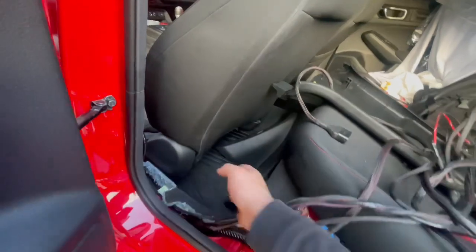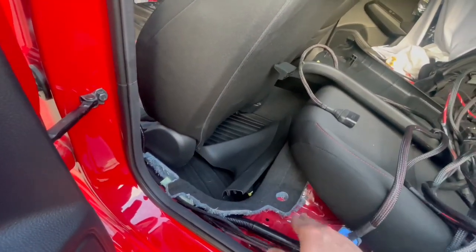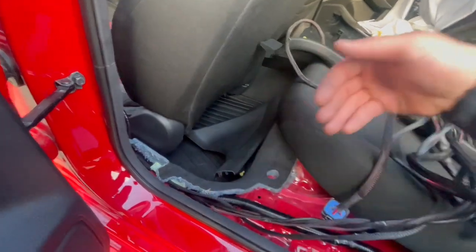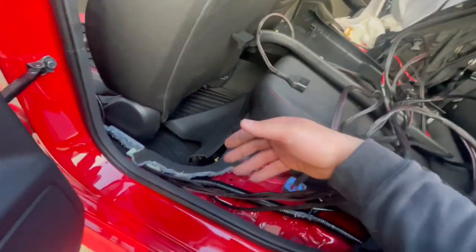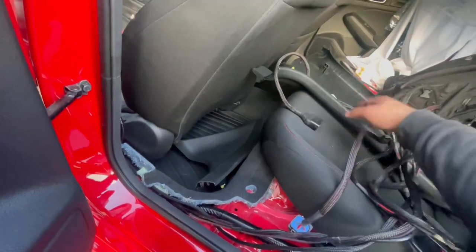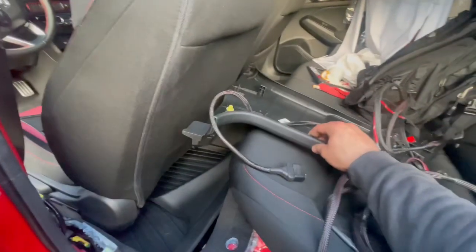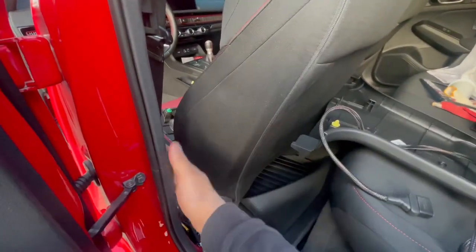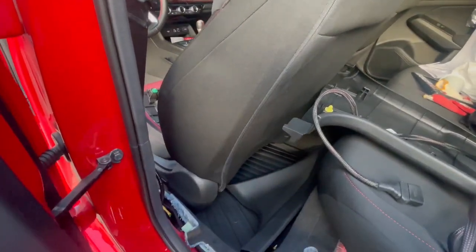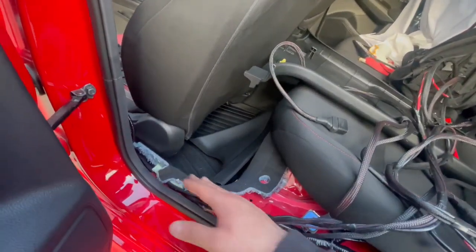And for the rear, you have this piece that goes under the seat, which you could just pull off as well, lightly. Don't yank it. You could do this lightly without breaking anything. Once you take off this one, you're able to take off this panel that goes right beside the seat belt. So once you take off this whole panel, you have all this opening, right?